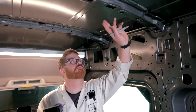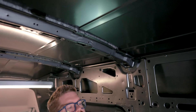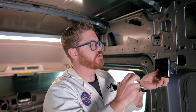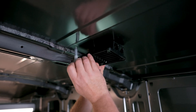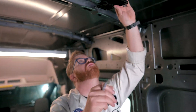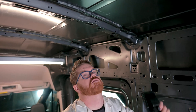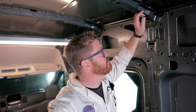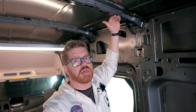To locate our entry gland, we want to be behind the c-pillar rib. Since my power is going to be on the passenger side, I'll put it here on the passenger side. We want to orient the entry gland with the front facing toward the front of the vehicle so our wires come out at the front half. I want to make sure all sections are nice and flat on the roof, avoiding this support channel — pushing toward the center a little more makes it a perfect place. Another reason I like going behind this c-pillar roof support is that all pre-wires enter the walls at this location, so I don't have to pass under a rib to get solar to the wall and down to my power station below.